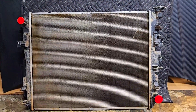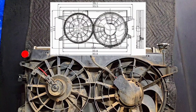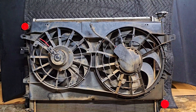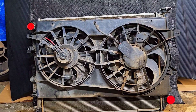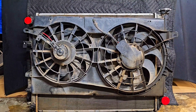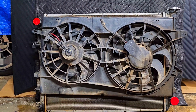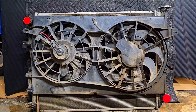I'm going to show you guys a quick mock-up with the Ford fan on it. What you're looking at in particular is a 1994 through 1998 Ford Windstar fan. From 1999 to 2003 they went with slightly bigger fan blades and went to a six-blade instead of the eight-blade you're seeing now. I couldn't really see any major performance differences between the two, but I'm sure they're more or less the same. Let's talk about CFMs — the smaller one and the bigger one push out roughly anywhere between 2,100 to 2,200 CFMs.